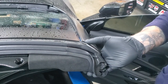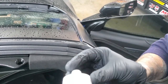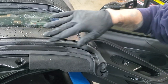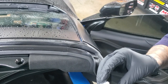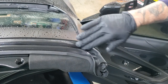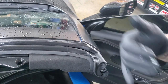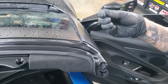The other part you're going to need to get to is the front of the car — same thing. Just take a little bit, put it on your finger, rub it around, and work it in. You can see the difference between treated and untreated areas: the treated part is just a little glossier. Again, just a thin, thin coat — don't need much. Particularly at the front, don't get any down in the channel, and don't block the two drains, or water will pool up and leak into the car.